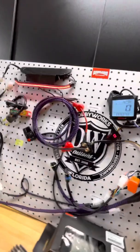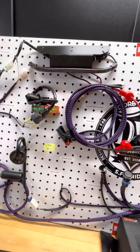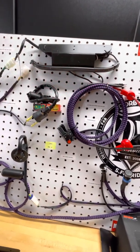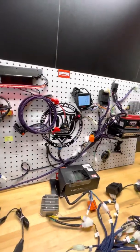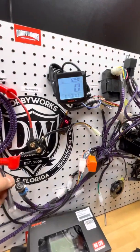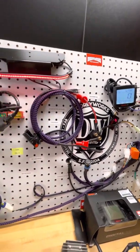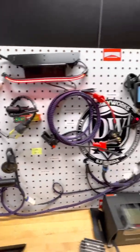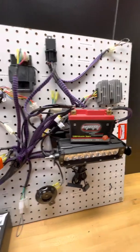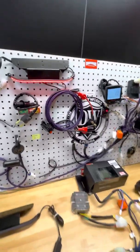I'm going to show you the brake light for your brake sensor. It has a flashing feature to let drivers know that you are slowing down. Along with the wiring system, we give you pretty much everything — fully TXL grade wiring. It's oil resistant and temperature resistant, so your wires do not get degraded over time. This is the same as Honda OEM colors and automotive grade wiring. Upgraded regulator included. We also offer an upgraded 11-pole stator if you don't have that in your engine already — that's an option on the website.